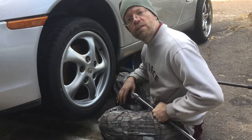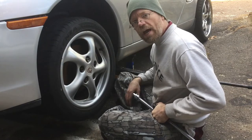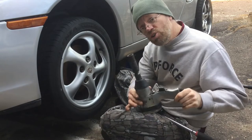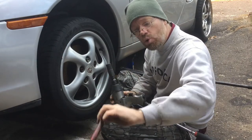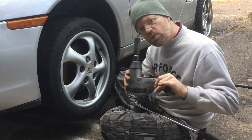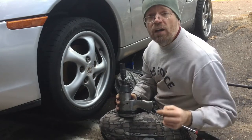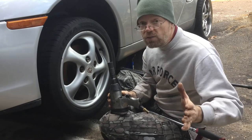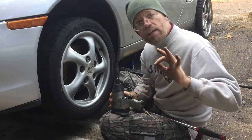Thanks for sticking around. I put the rim on with just a couple of threads to show you how to properly put the lug nuts on. Never, ever use this air gun or any high-powered electric or air-compressed tool to put your lug nuts on. I've seen professionals do it, but it only takes that one time to do it too tight, snap the stud inside, and then you're stuck. You'll bring it to me and I'll have to use my special extractor kit, possibly damaging your rim. Take a couple of minutes and do things properly.